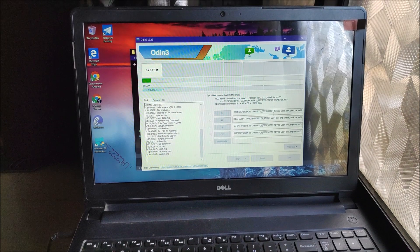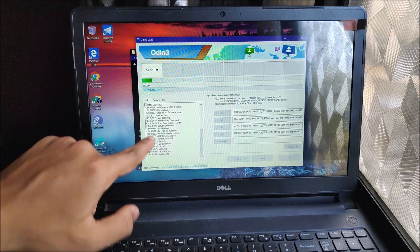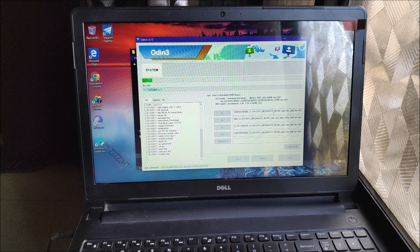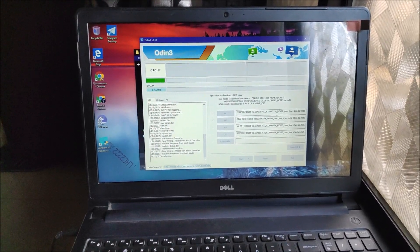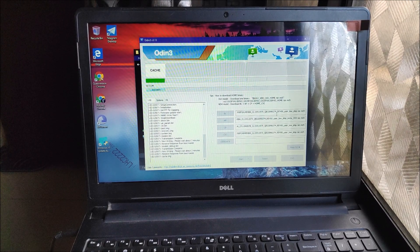The process is still running and it didn't fail for me. In rare cases it may fail - especially if you're coming from a custom ROM to stock ROM. In that case, go into Odin's Options and check 'NAND Erase All'. This will remove all your old custom ROM files and install a fresh firmware on your device. Let me skip ahead to the end of the installation process.